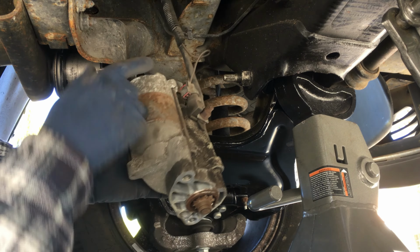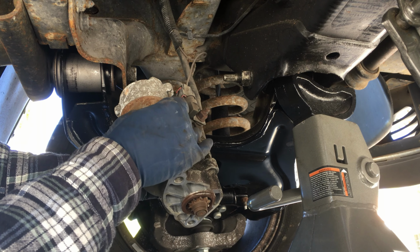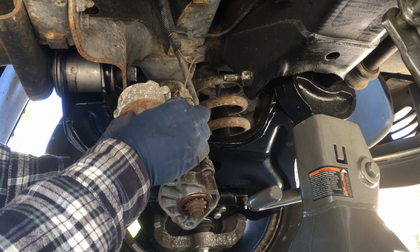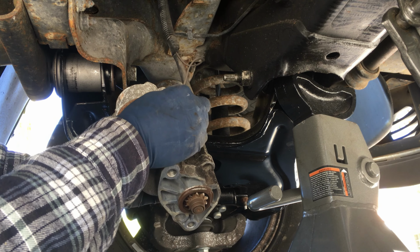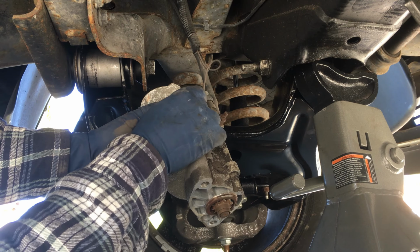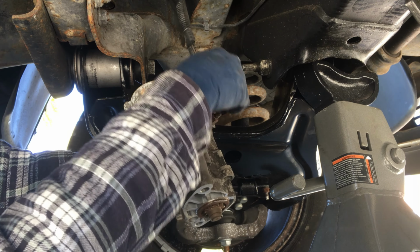The first wire to remove is the trigger wire, and it's held in with a clip. This particular clip has a red safety release that must be pulled up in order for the clip to pull outward. It may be stubborn, so using a small screwdriver to pry up on it may help. Once pulled up, press the tab and pull upwards.